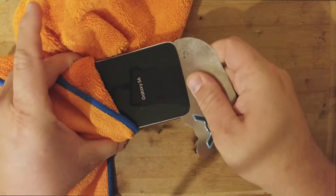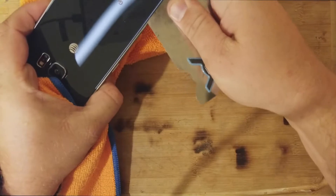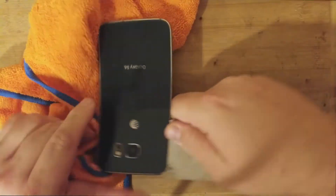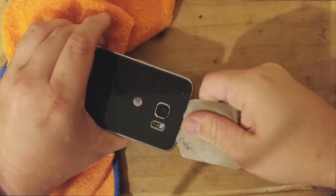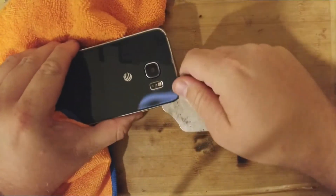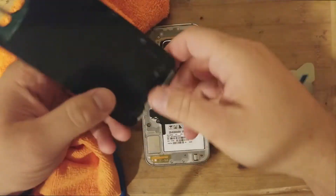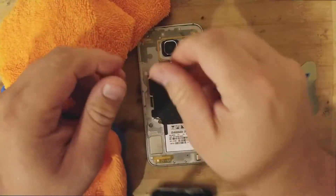It's fine if it's on. I've worked on several of them that have been on when I'm working on it — you just don't want to have it too hot for too long. We're just slicing our tool. Not too deep now because there's the wireless charging, and then that paint does scrape from time to time. Nothing you can do about it, unless you use a suction cup and all that jazz, but I never use suction cups. So now that we remove this, remove any excess adhesive.